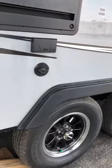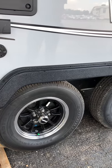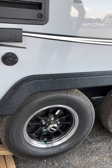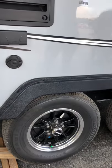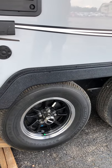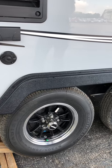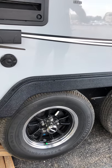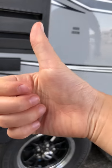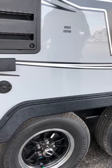Your tires have been filled with nitrogen — you don't have to refill them with nitrogen, that's just how they all come standard. With the wheels, they've already been torqued for the lug nuts down to 110 pounds of torque. We recommend for your first time driving, in increments of 20 to 25 miles up to 100 miles, just double-check them. And then before every trip in the future, just make sure those are really, really tight.